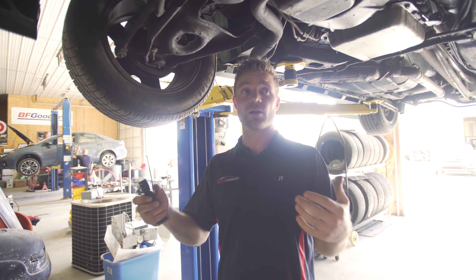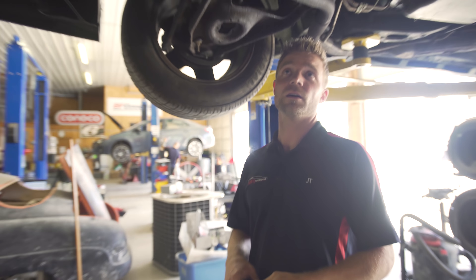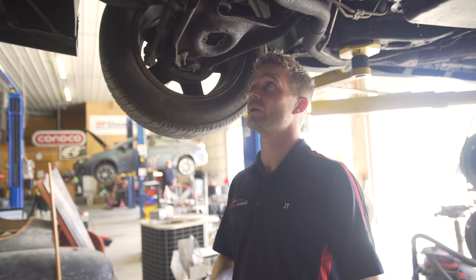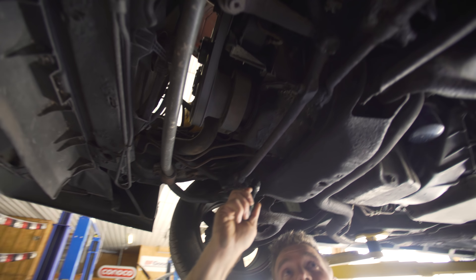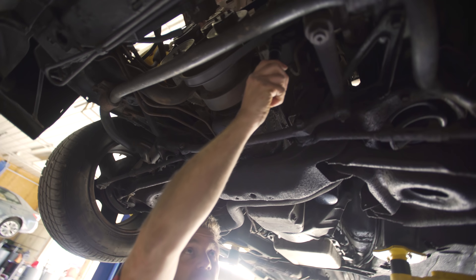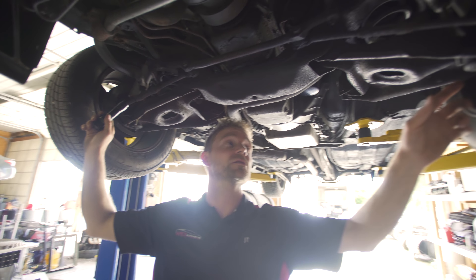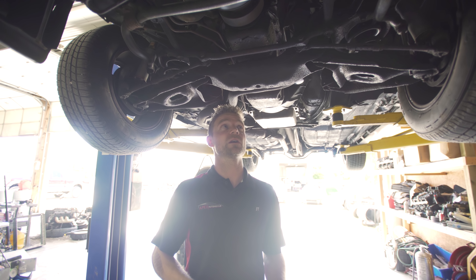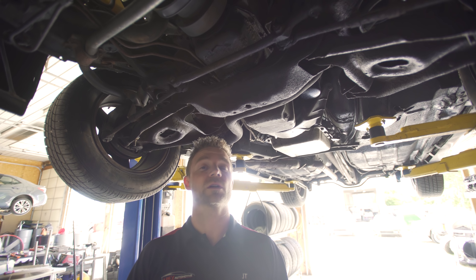Just up in the air with vehicle weight off the tires, we check to see if there's any play in the steering and, if so, where it's coming from. On these old steering-box style cars, they don't have a rack and pinion — they have a box, pitman arm, center link, and then inners and outers, so there's a lot of room for failure. A lot of ball joints that could go out, so we're going to check that now.